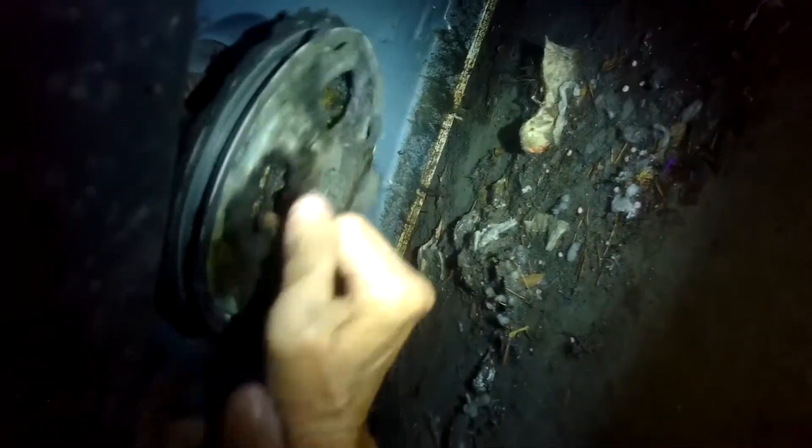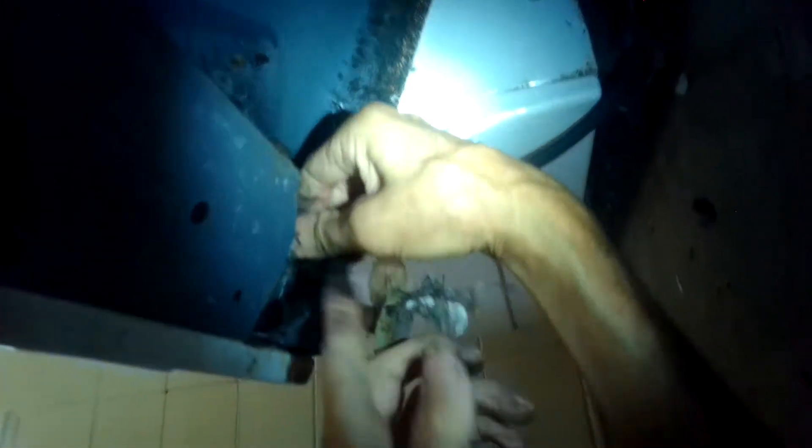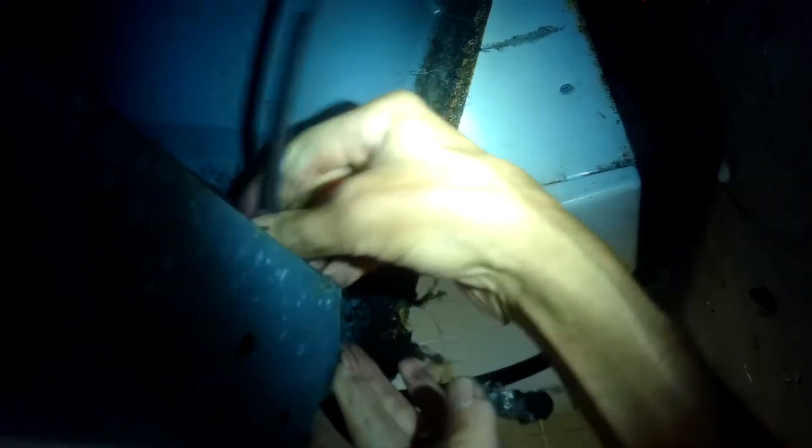In the agitate direction going left it seems fine, but going right when it has to move the spin basket it's really difficult. It's pretty rusty inside — it's an older unit. I think the bearing is so corroded it's causing a lot of friction and preventing the spin. Changing that main bearing is a pretty big job, and because the machine is so corroded it may be best to just get a new machine. I'm going to check first to make sure there's nothing caught between the spin basket and the tub, which is easy to do — sometimes when you overfill it, a sock or article of clothing gets in there and creates so much friction the spin basket can't move, and it burns up the belts.